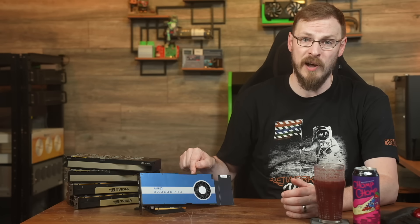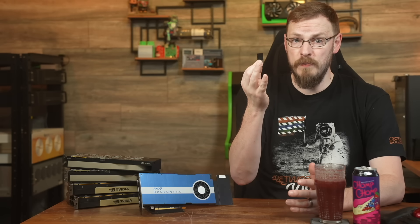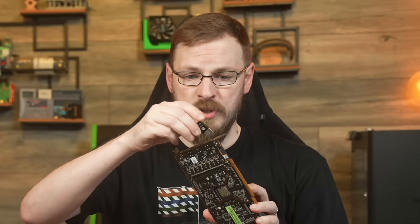Don't expect much difference in performance even if you're still on an X99 home server, as most games are going to be GPU limited with this card. On top of a server, storage, and a graphics card, you'll also need a dummy display dongle, as GPUs need to think there's a monitor plugged in for remote streaming to work. GPUs don't know what to do if there's no monitor to render onto, and a display dongle like this emulates a display at pretty much whatever resolution you want. And that plugs into your graphics card, just like that.